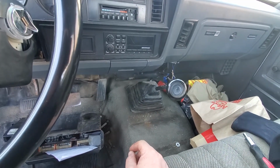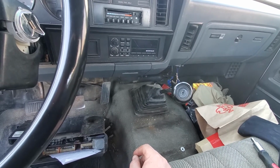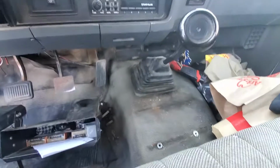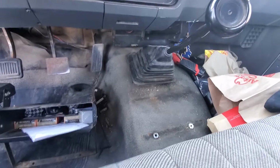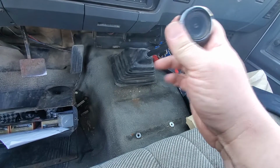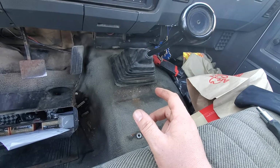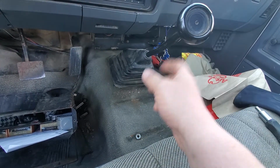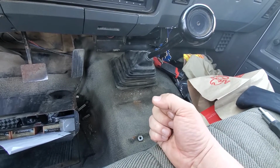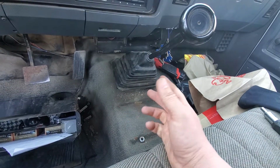Good news though, when I started the truck back up, again like a dumbass, because if I had broken something I would have made it incredibly worse by having metal go back through the gears, it wasn't making all kinds of crunching and munching sounds. So I'm hoping, from a little bit of reading on the forums, that all I did is pop the transmission's stick out of the range for the forks to actuate. Then I can remove this boot, the shaft, the stub, and the snap ring, use a long screwdriver to manually put the transmission back into neutral, cross my fingers, and hope that fixes it.